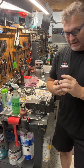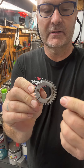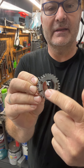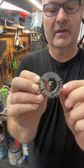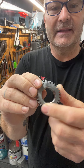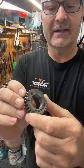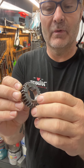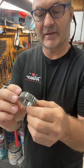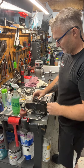Here we have a 28-tooth gear. If you look at this gear, we put etching on the outside of it — the name, how many teeth, and your mark — so you know how to make sure you put this on the right way. On this side there is a big bevel on the inside, and on this side there is not. All the wording you want facing out away from the crank. The bevel you want to go up against the crank, which is where the bevel is on the crank.